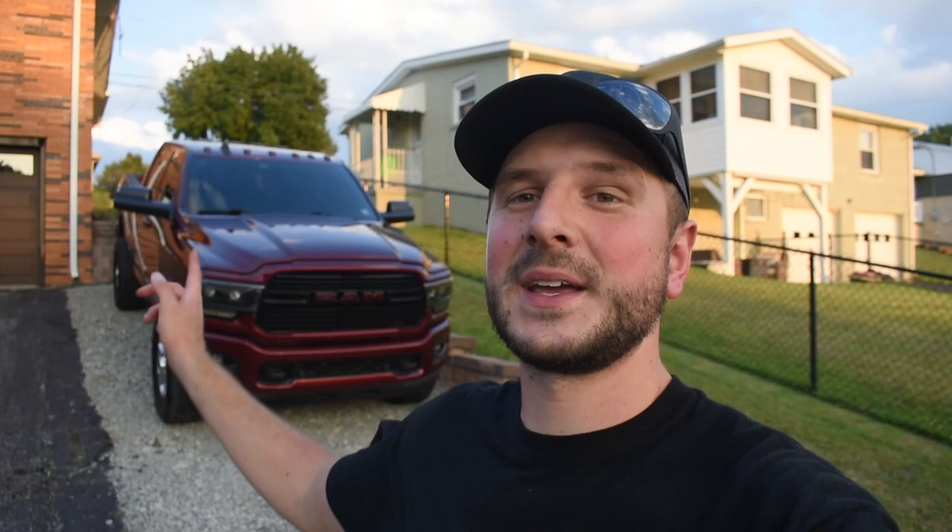We are home - I don't live very far from work, like 10-15 miles. Everything feels pretty good. I did a highway pull because some kid in a BMW thought he was cool, so I did an on-ramp run up to about 95 before hitting traffic - everything felt fine. I'm going to drive it for about 100 miles, pull the wheels back off, re-torque the spacers, and then check again after another thousand miles just to make sure everything's good. That is all I have for you guys - like the video, subscribe, join the Cummins build, and I'll see you next week. Peace.